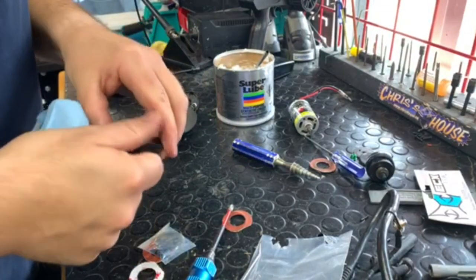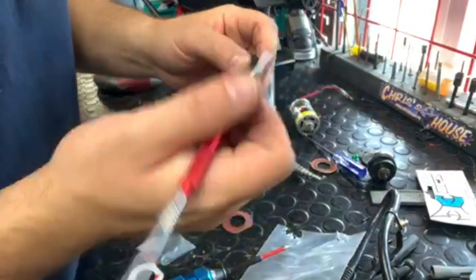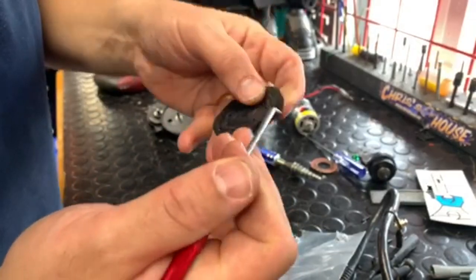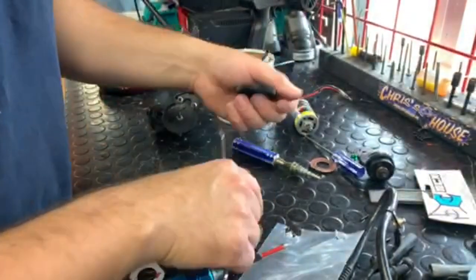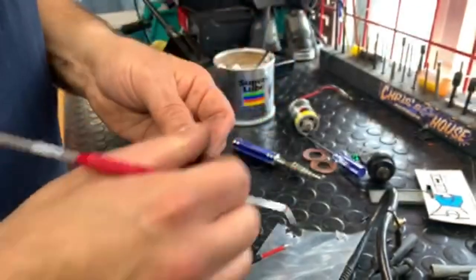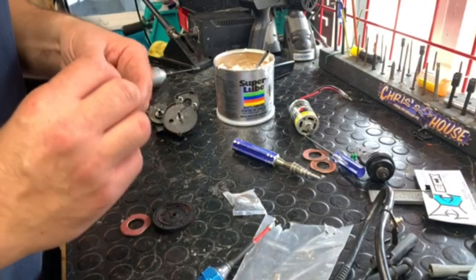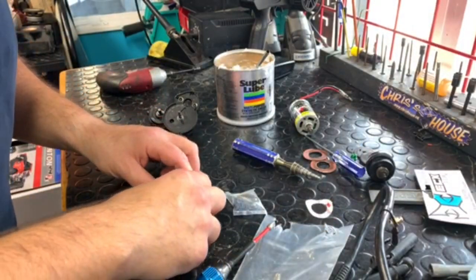Let's also inspect the spur gear as well. Make sure there's no debris, and these dental picks are great. Let's just make sure that everything's cleaned out. Everything's pretty soft in there, it might just be, yeah, actually it's debris from this that got in there, but other than that, that's okay. Everything looks good, okay? You have two discs here, so let's just get the backing peeled off, and we don't wanna touch the adhesive. Peel the backing off.